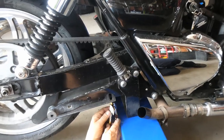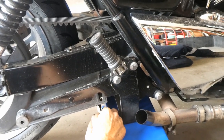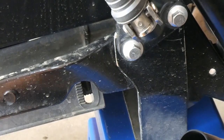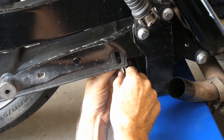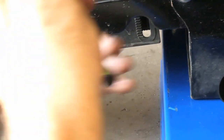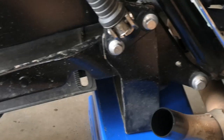You don't use the top to measure with. Simply put that in the belt, slide it up against there. This is of course with the back wheel off the floor. Adjust so that the belt and the gauge meet at the same time, then press up on the belt until you get the required tension, which is about 10 pounds. You can see it's way under tension, so using that spanner, simply crank a bit of tension in the back end.